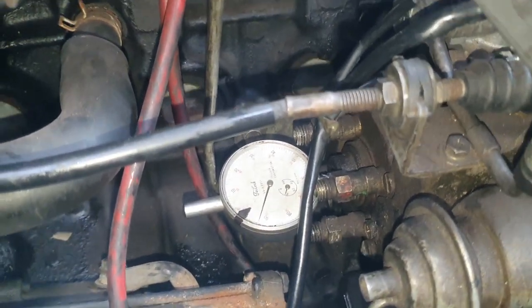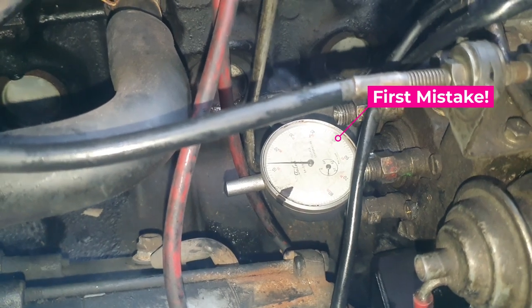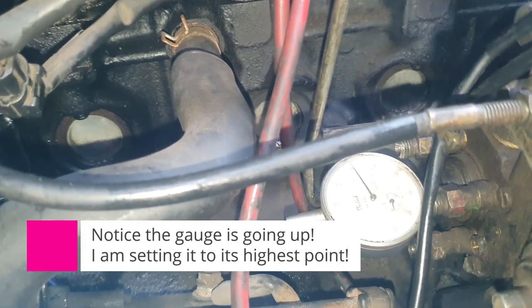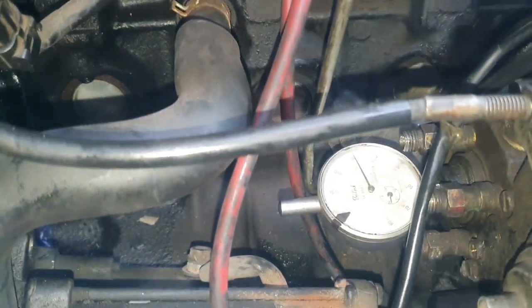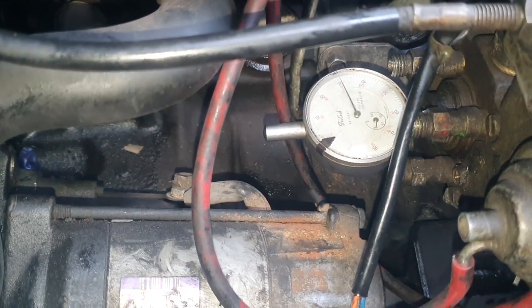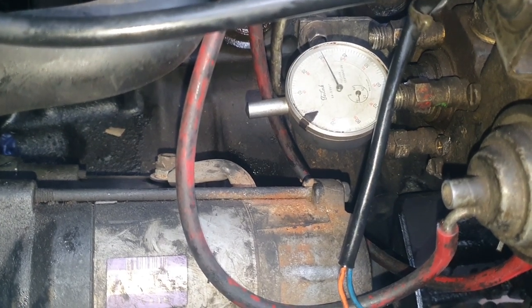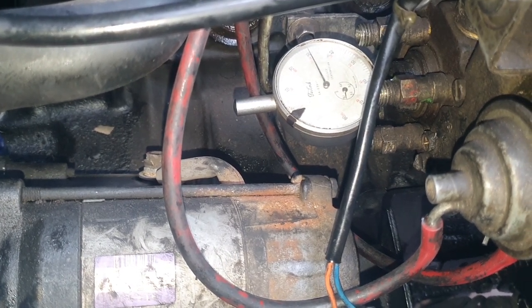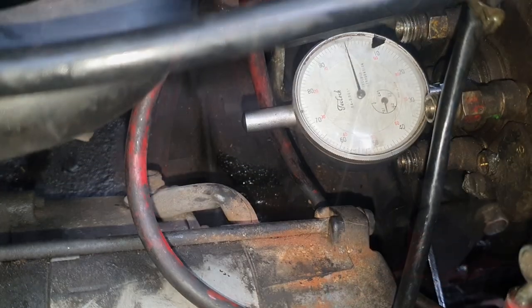What I'm now going to do is turn the crank until that needle doesn't go any further. It's going back up — that is my zero position. So, now, with that in position, I'm going to set that to zero by turning the dial. And then we'll reset it to 10 degrees past top dead centre. And then we'll adjust until it's at 39 thou or 1 mil.